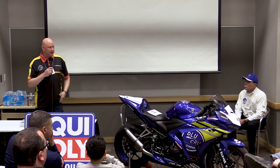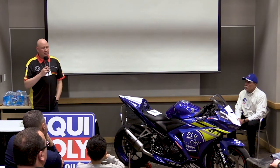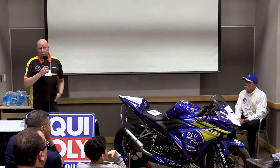It was introduced just after August in Moto America. We were down at Pittsburgh, and Colin and I and others were even commenting that the lean angles are much greater. The tire is essentially a street tire. It is excellent with no warmers, and we don't feel that they are necessary. Now, that being said, we do have exceptions at times: cold, chilly mornings, that first race of the year at Shannonville in June or end of May, and even Grand Bend. And at that point, Colin would give you an extra warm-up lap.